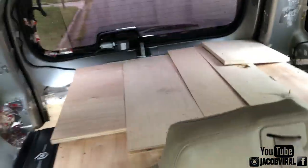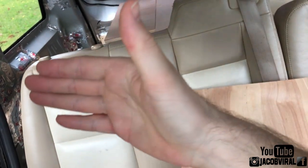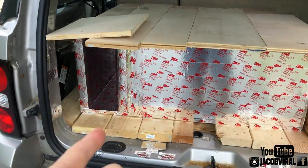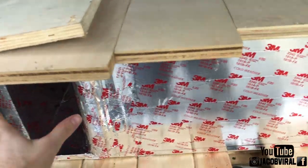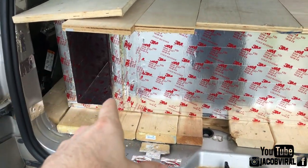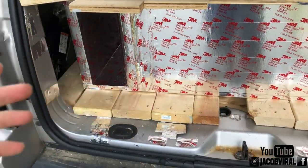Jacob, that would be stupid — why would you do that? Well, you'd be surprised. The length or width of how far my port is from the back of the hatch affects output, but also what's around you affects output. Think about this in a wall build or trunk build concept especially. You have a lot of infrastructure and cabin space you could utilize or alter with your box. I was curious: if I block how my pressure containment goes up and over, how does it differ when I block that off? So now I'm going to adjust my loading wall by putting a couple baffles stacked in there and see how that changes.